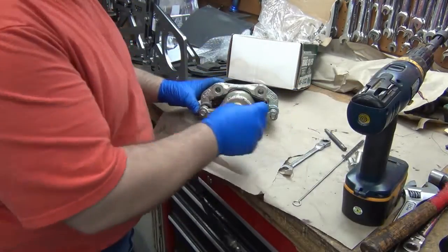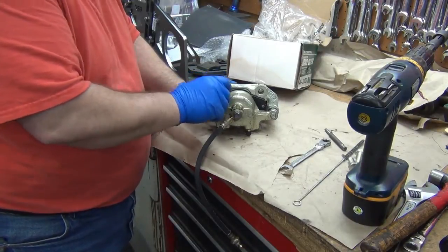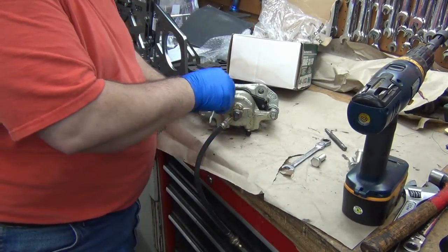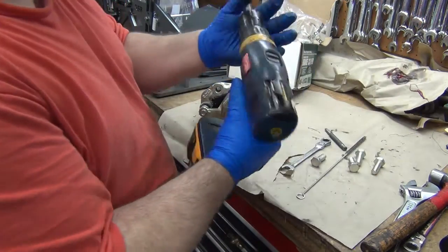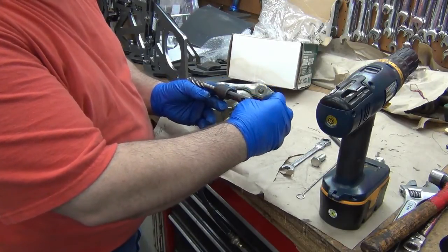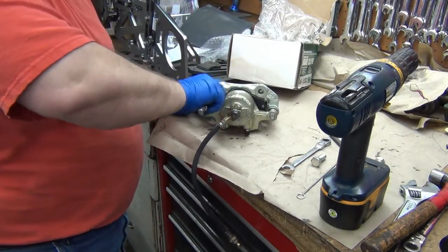Well, this is another one of those drawbacks of Rock Auto, okay? All that corrosion that we saw and everything else, it's inside the bolt holes there too, because they didn't get plated as well. Okay, so they're too tight. You're gonna have to fight back and forth, wire brush. Since I already have one, the easiest thing for me to do is take a tap, and let's see, this is a 12mm by 1.25. And I don't want to start it under power because it's got existing threads.